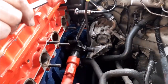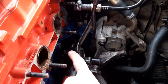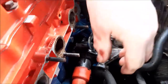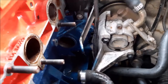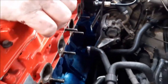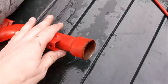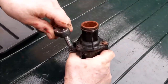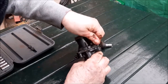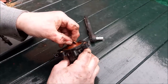That's it out - it takes a little bit of wiggling and levering. You can hopefully see down there that the thermostat housing goes into that almost side bit at the back of the engine. Now all we've got to do is pull that away and we can have a look at the thermostat. With the thermostat housing clear, you can see the hole down there where it went in - that's actually the back of the water pump there. We've removed the thermostat housing and now we're undoing those three bolts to split the housing apart and remove the thermostat.